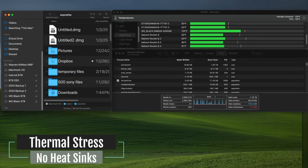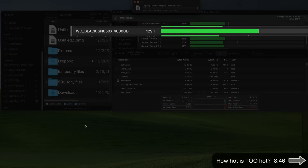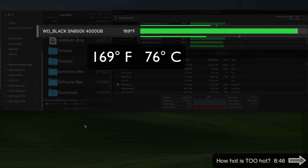We're going to put them through a real stress test using the Western Digital 850 Black 4-terabyte version, because it generates a lot of heat — much hotter than my 990 Evo or any of my old OWC SSDs. The first test: we're cranking about 800 gigabytes of data from a 400-gigabyte file, which will really push the temperature limits. First, we'll test it with no heat sink attached. We're dropping a 400-gigabyte file onto the SSD, starting at about 127 degrees. Jumping ahead to the end, we're getting close to 170 degrees — way beyond the rating.